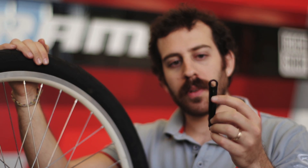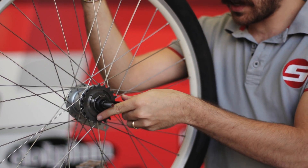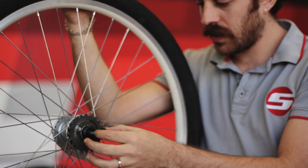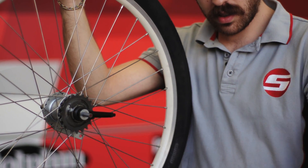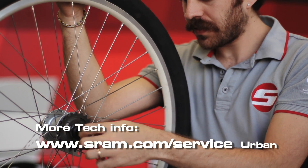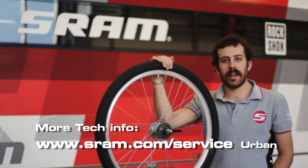My cable connector arm goes with the ridge facing out and slides onto the axle. I'll take one spacer, slide that onto the axle. My no-turn washer with the serrateds facing in, and then my last axle nut. Now everything's back together. I'm ready to put it back on my bike and go for a ride.